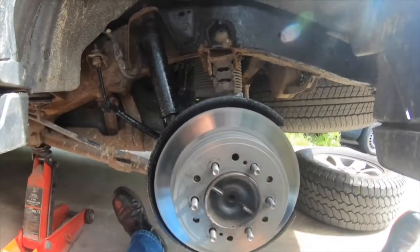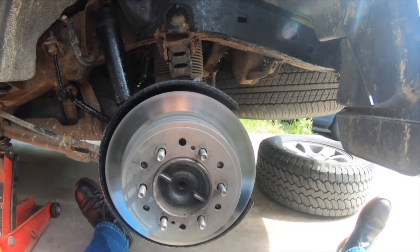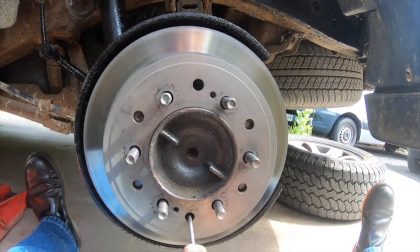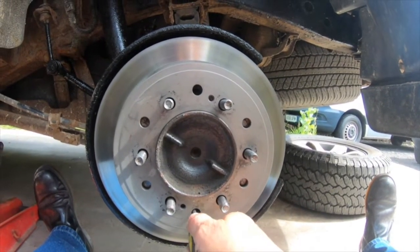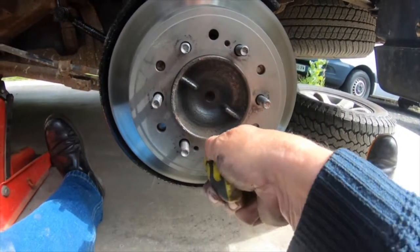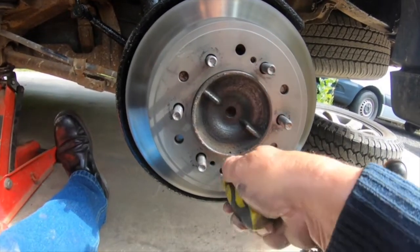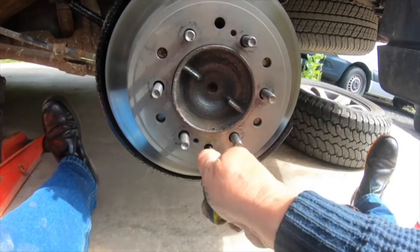So it's out of gear. It is an automatic, but it's out of gear. Well, it's in neutral. And handbrake's off. So what you've got to do now is try and find that little cog in there. Just feel around, you should get it. You can hear it there going up. That's adjusting it. Turn that till it locks.